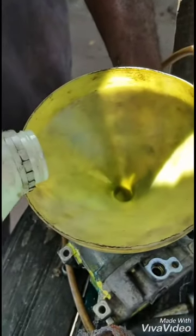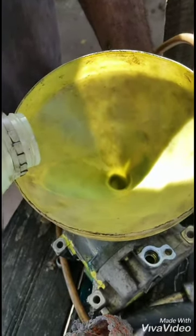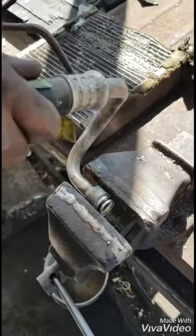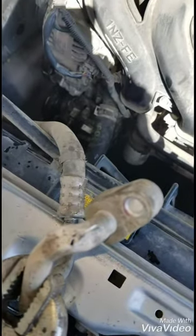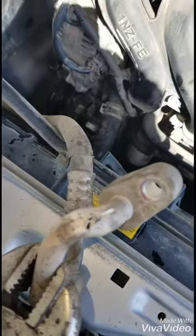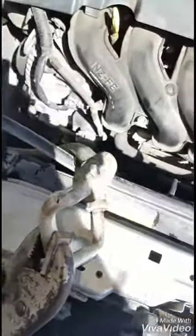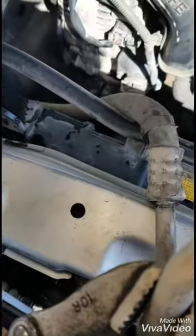Gotta make sure that we put some oil in the compressor to make sure that it lubricates. So we are making the adjustment by heating the pipe and bending it. So guys, in the process of heating this outside pipe to adjust it for the compressor, that normally happens based on the turn. If I want to almost hit a 90-degree turn, the pipe will crack.